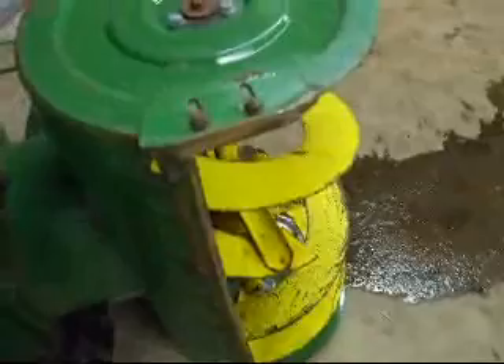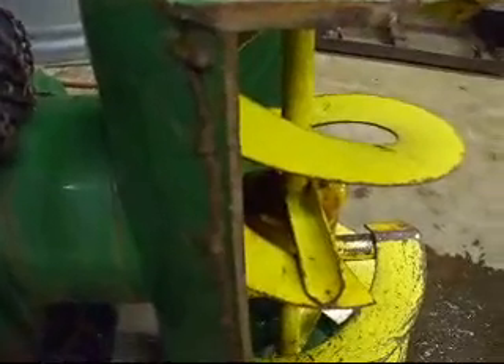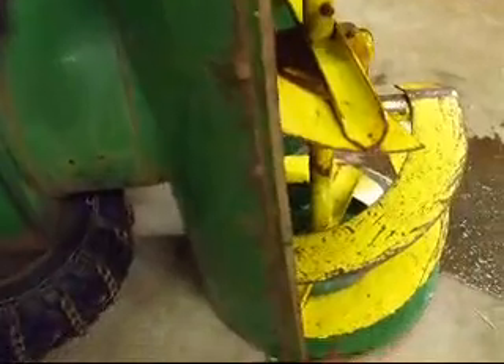This is 3-1 Pockets back again. Now I've got my work clothes on and we're getting ready to start working on this project with the John Deere Snowblower. The first thing we're going to do is repair the bottom of the deck. As we can see, somebody had let the scraper bar wear out and kept using the snowblower anyway and wore the bottom of the deck. The scraper bar barely attaches — part of it is eaten right off. This part of the machine is going to be repaired and replaced. That will be the very first thing we do: straighten out the bottom part of the deck.